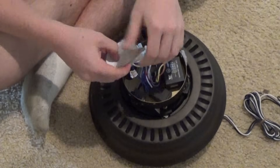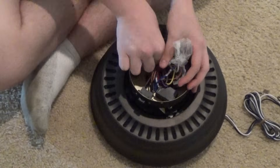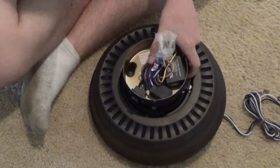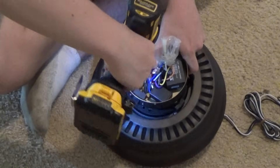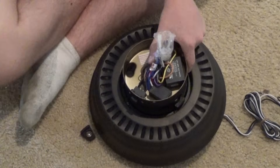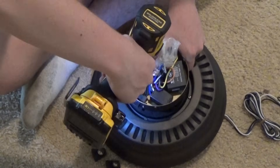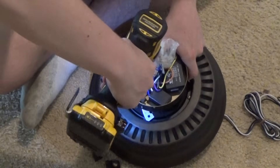The next step is the fan motor. Remove this little piece of paper and there's a rubber grommet that you need to push out with your finger. That gives you access to get a screwdriver down to the screw. We're using a drill because there are a lot of screws today. Basically what you're taking out are these little spacers — they're installed from the factory just to protect the fan during shipment, and you have to remove them and throw them away. You have to spin the motor a little bit to align the screw with the hole from the rubber grommet, then remove it. Note that this hole is also the hole you'll use to install the fan blades later.